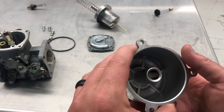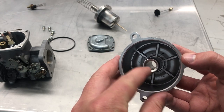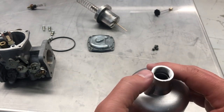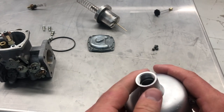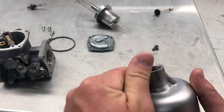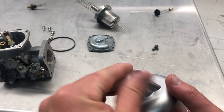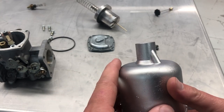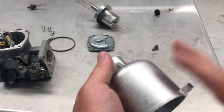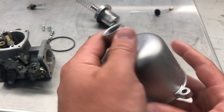You have to make sure that you get into all of the little deep cavities, nooks and crannies. You can see how it cleaned down the bore — it's incredible. It cleaned all of the threads in the part. This would take you forever trying to hand scrub. Dry glass beading is just not going to cut it because you're throwing dry abrasive at a part that already has corrosion and contaminants on it, so you're just moving the material around. In the vapor honing process, it's washing it away while gently scrubbing the surface — that's why we're not actually removing these casting marks and corrosion areas.